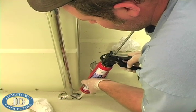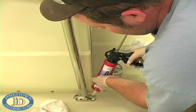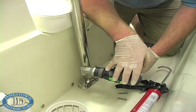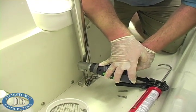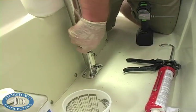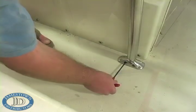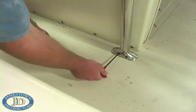Pump all 8 deck holes full of sealant. You may find it easier to mount the feet if they are detached from the uprights and individually installed. Run all four screws 90% in, then go back with a low torque setting to finish tightening the four screws, taking care not to over tighten and strip out the holes. Screwing in by hand will give you a feel of just how solid your deck is so you can anticipate how well the screws will bite. Now that you have the feet attached to the deck, reconnect the upright to the feet and turn attention to the standoffs.